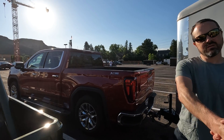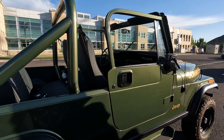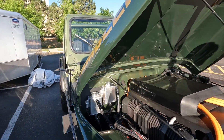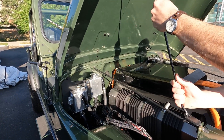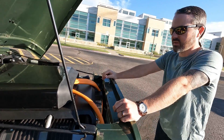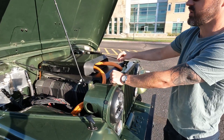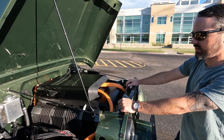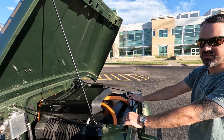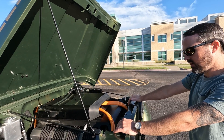Carter gives a walkaround starting under the hood of the Scrambler — not too many of these left. The motor is from Electric GT out of Southern California. Most of the EV components came from them: inverter, main battery pack, motor, high-voltage junction box. There are fans for the two cooling loops, another battery pack where the fuel tank used to be, and a small one in the utility box in the bed along with the charger and the 12-volt battery. The total pack size is 53 kilowatt hours.